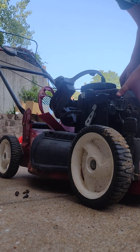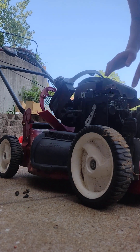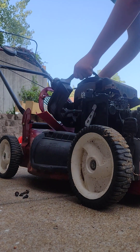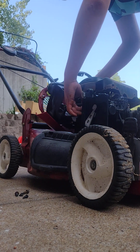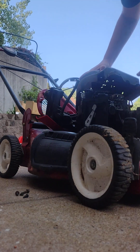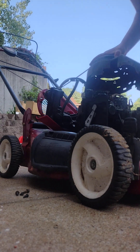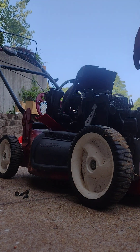There is a little mini spring you don't want to lose — it's attached to it. You guys can see it just popped right out. You're going to want to take out those bolts. Sorry guys, that was the gas tank. You want to take that out. Look at what's hooked up — that was just under the cover. A lot of things. So we take that out, lift out those two things, and then we've got the magneto exposed.